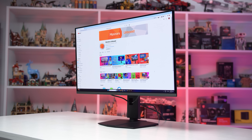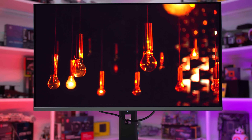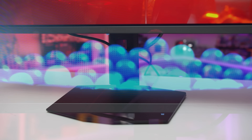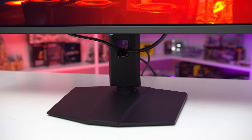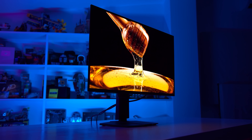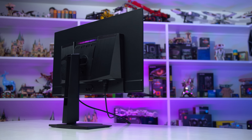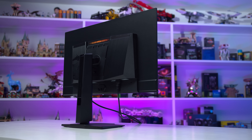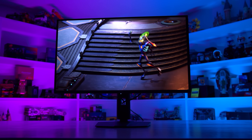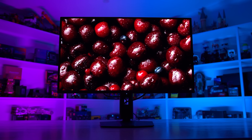As a reminder, burn-in with OLEDs is directly related to hours of usage and is cumulative. If you only use static apps for 4 hours a day, you should expect roughly double the lifespan compared to 8 hours a day. Mixing in dynamic content between periods of static use usually won't improve burn-in or clean the screen — it's all about cumulative hours of static content. Based on these results, I currently believe an OLED will be okay for productivity work for between 2 and 3 years depending on usage frequency. This QD OLED seems to be a bit more resilient to desktop burn-in than I anticipated.